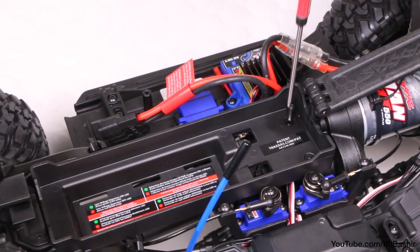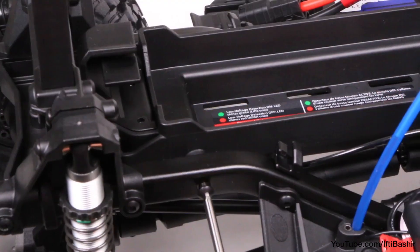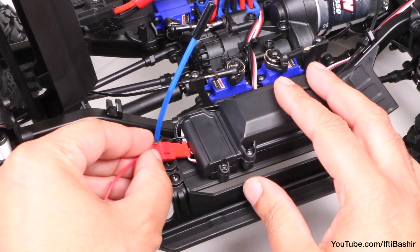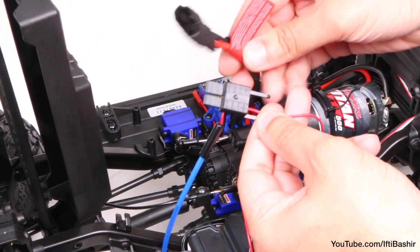At this point you may find it easy to loosen the battery tray — simple with two screws at the bottom and two on the sides — so we can feed the wire beneath and maintain a tidy install. One end of the power tap attaches to the spare red connector we left at the receiver, while the other end connects to the end of the battery plug.